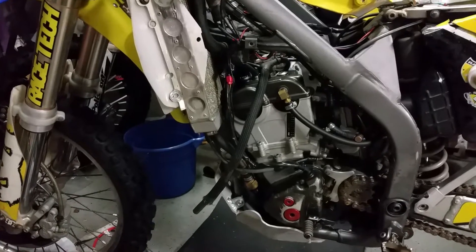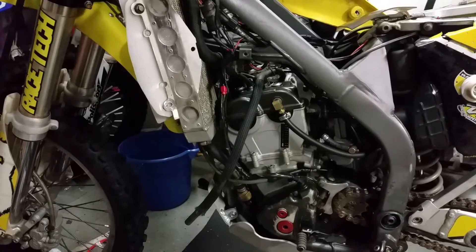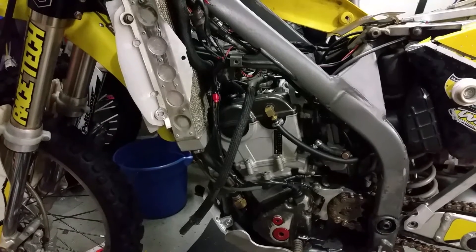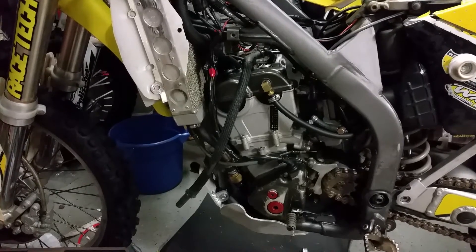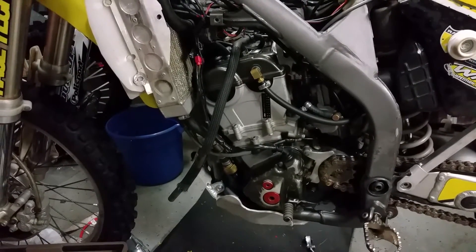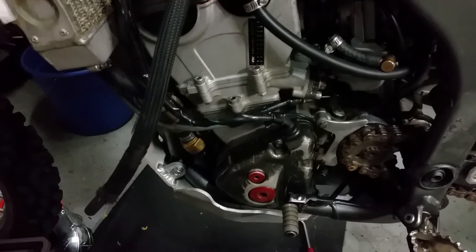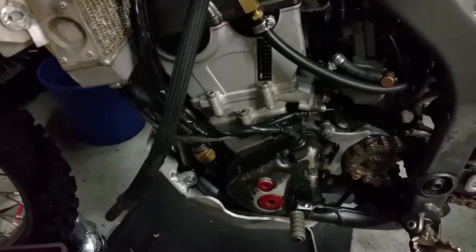As you know, there are some problems with these engines, but I believe most of it was from overheating. I moved up to Connecticut and there are a lot of tight trails up here, and I was having problems with overheating and getting stuck in mud or on hill climbs, so I wanted to add a fan. There's about 30 watts available — this comes with a lighting stator, so you don't need to spend $150 to get a new stator.